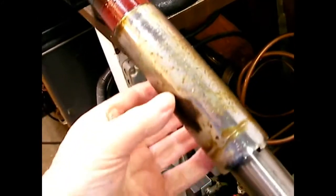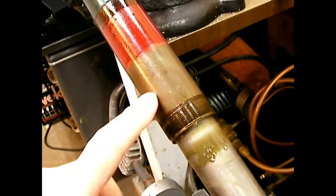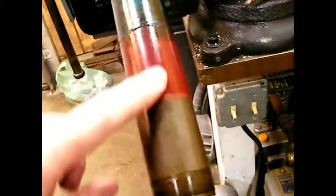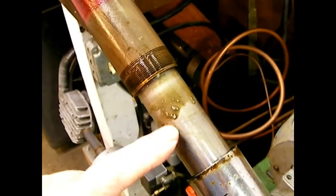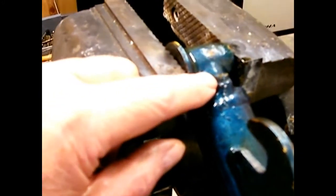It's a real fine thread in this sleeve. I want to put it in some acid to strip some of the chrome off and polish it in the lathe before taking it to the platers. You can now see the threads on the lower fork leg, and you can see the original color of the bike — kind of a deep dark red, they call it maroon. But if you look at this oil and see the little bubbles in there, that's water. Somehow water got in that fork, and it didn't have much oil — what's in there is really thick, probably been there since 1955. People never change their fork leg oil and they should. Most forks have a drain screw to change the oil every once in a while.